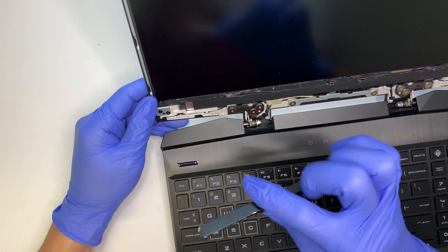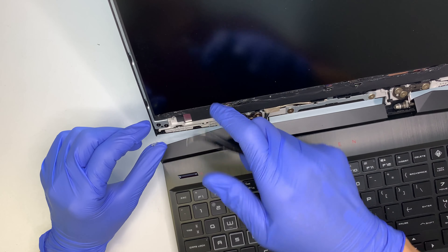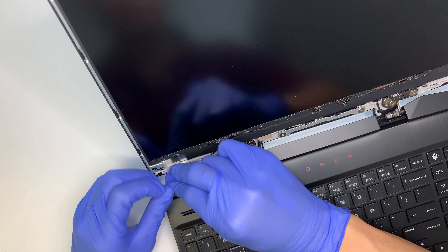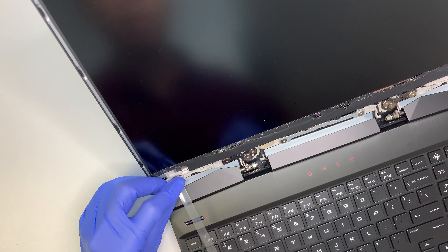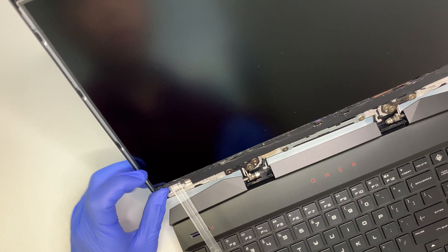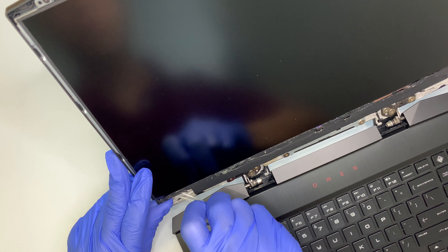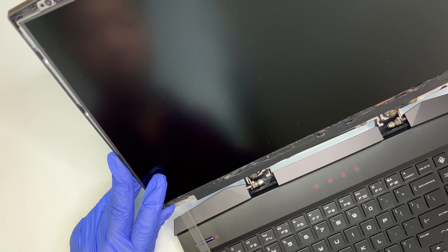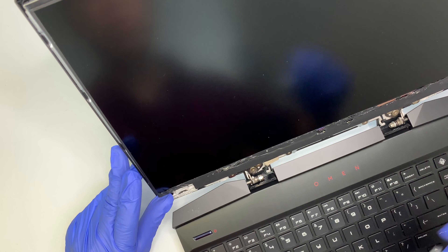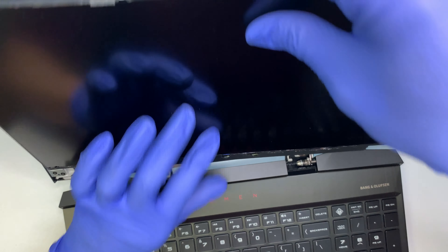Let's put it on the side — there are actually two of them, one on the right and one on the left. Let me go ahead and remove this as well. What you want to do is take your time when you pull the tape, pull it as slowly as you can and try not to break it, because once you break this double-sided tape your screen is not going to come out — it's still glued on. Alright, I have both of them removed. Now your screen should just come right out without any problem.